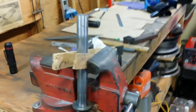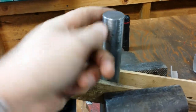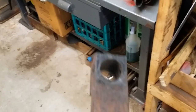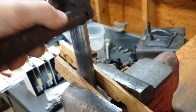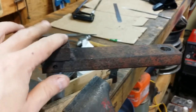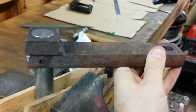To make sure I didn't damage anything, I took the wasted spindle - the spindle I cut - deburred it where the hacksaw had made a burr, and sanded it down quickly to make sure there was no rust. Same thing with the inside of the knuckle - I gave it a quick sand with 80 grit to get some of the rust out. I wanted to slide it on to the end to make sure there was no meaningful slop in the bar, and it goes on perfectly. I was able to save that knuckle with very minimal damage. I lightly filed where I made the nick, sanded it off, cleaned it up inside, and it fits with no slop. That'll go back together just like factory.